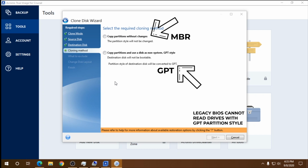So, alright, what if you still want to convert and clone? Well, you can, but if you have legacy BIOS instead of UEFI, then there's no point really, because BIOS can't read GPT drives. If you're sure you have UEFI, then you may convert and clone. Just remember to change your BIOS to UEFI. There's one more way to convert to GPT. I'll have the link in the description if you want to read how it's done. I'm not going to go into that in this video.